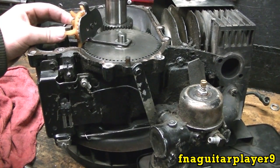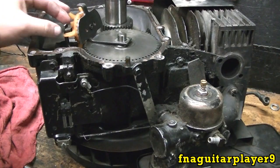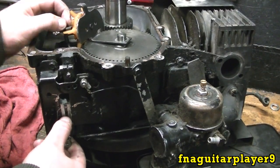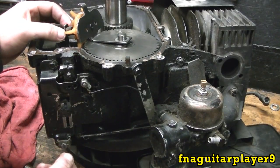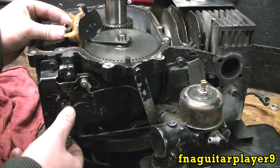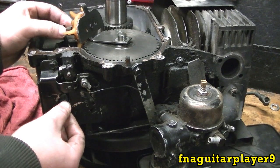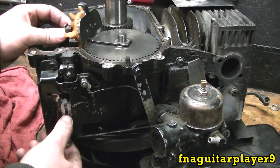It's pretty neat how it all works. If you can't see it all like this it's hard to visualize. When you get your throttle up it does the same thing — there's so much tension. The spring tension overcomes the force of the weights more. Right there is a good example — as soon as I start giving it throttle it closes. You can see how that works.